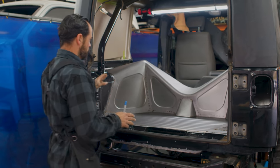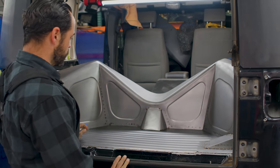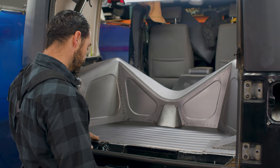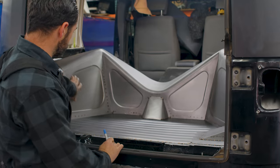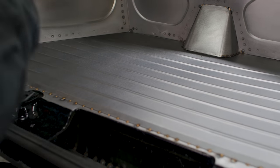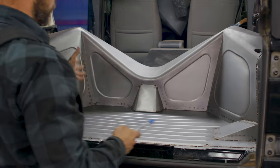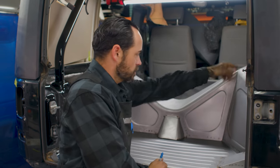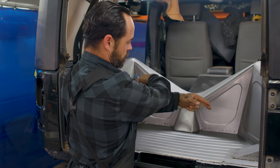This is kind of what we went for. The shock towers are obviously enclosed in here and done — we'll be able to see them through the side of the wheel openings in the rear. We always do traction ribs for utility areas like footwells — anywhere you're going to set something down. This adds extra stiffening instead of just a step bead roll. A rib not only stiffens the panel but makes it a lot less prone to denting and creasing. Functionally, there's a big X that goes through here, ties into the frame and the coilover mounts. We did not want to just connect these straight across — if you have an X that's spread out enough to tie them in where they feed off each other and cross right here, that gave us a lot more space.